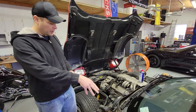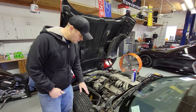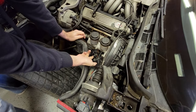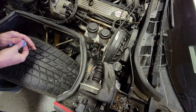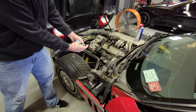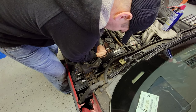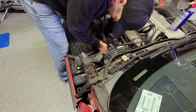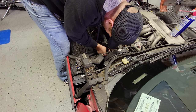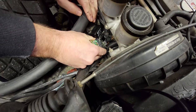We did the diagnostics check — everything checks good, fan came on. So the next thing is to start troubleshooting the relay, the fan relay right here. If you come in closer, you'll see this one has a bit of silicone on it and it's bubbled up real good. We have an extra known-good one, so we're going to unplug this one and plug the good one in. She's bubbled up good — Bubba done got her. It's broken in half. That is smoked.